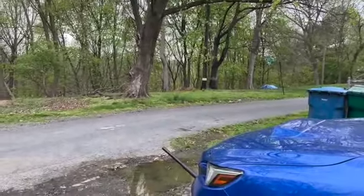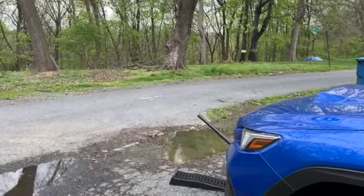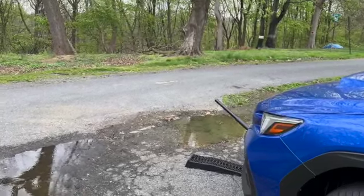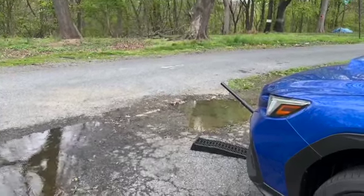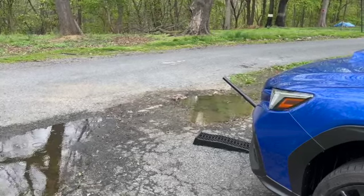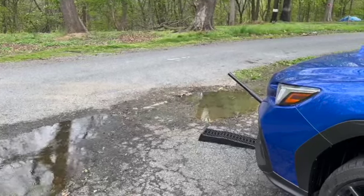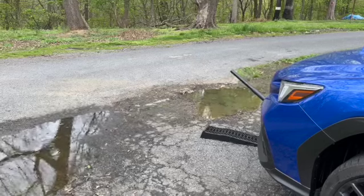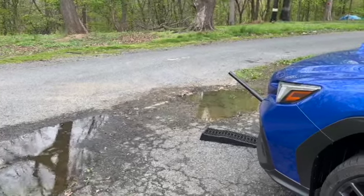This is exactly what you can expect when you install these brakes. This dark silver metallic with crystal clear coat was a perfect option, especially with these stock wheels — I might not even get another set powder coated. These big brakes will clear your stock 18-inch wheels without any additional spacers — no five-millimeter spacer, no three-millimeter spacer. Just bolt the wheel on and it clears perfectly. The gap is tight — maybe the thickness of a debit card and a half between the rim and the caliper.